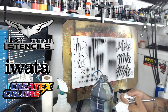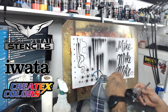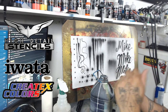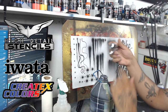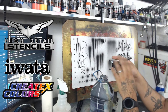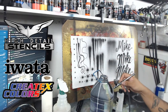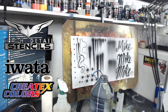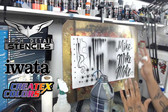I would treat it like a toothbrush. You walk up, grab your toothbrush, rinse it in the water, put the toothpaste on it, brush your teeth, and when you're done, you rinse your toothbrush out again. Same thing here. You can rinse it before you use it, spray your paint, do all that, then come back and rinse it out again, making sure it's nice and clean. And then I like to let it sit with a little bit of reducer in there, just so that any paint that might be left over doesn't dry up right away.